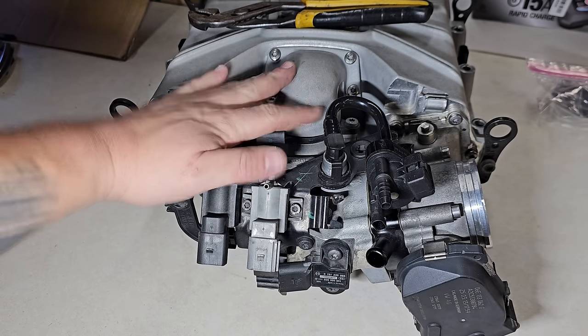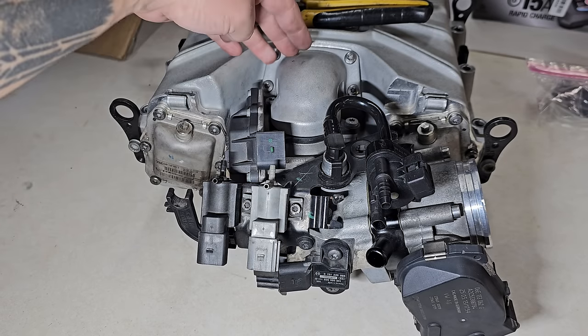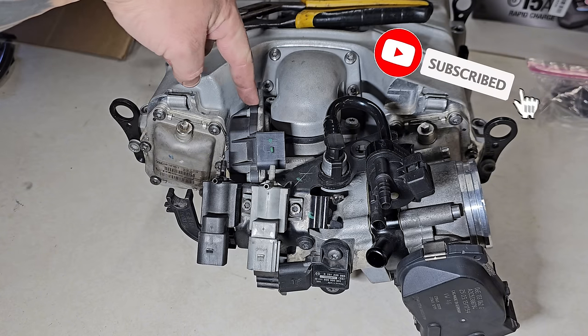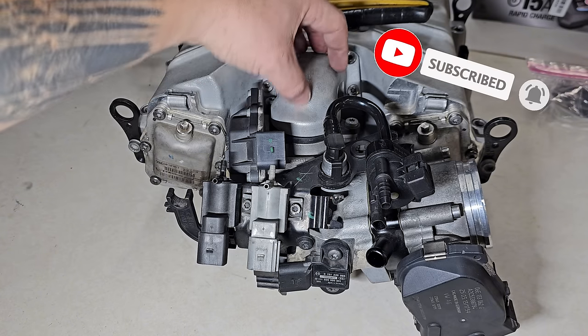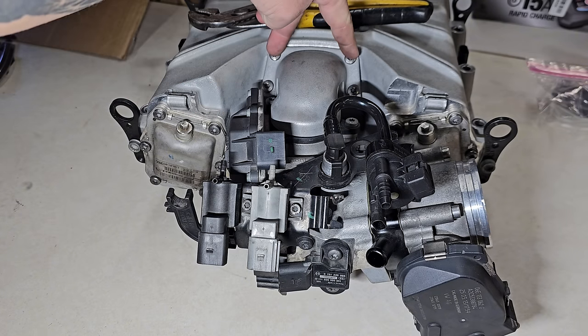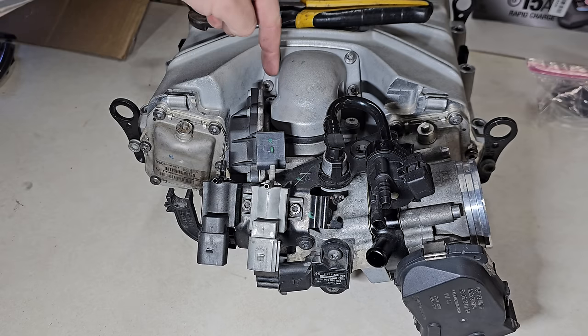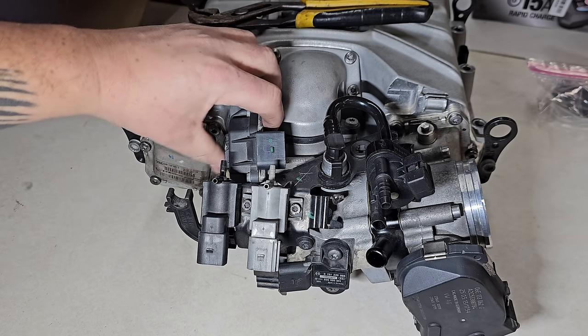There are a few things we need to transfer from your OEM 1320 setup over to the Merck Racing MRA 1900. Starting at the back moving forward, we're going to be using your OEM bypass valve and we don't need the noodle here. Just the bypass valve — to remove it, take the four T30s off holding the noodle on, remove that, then there are three vertical T30s to remove and it will come out.